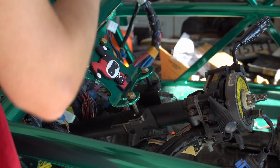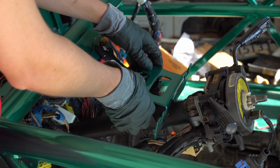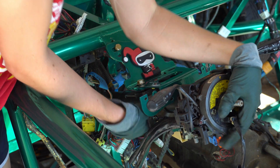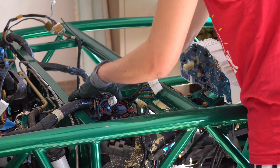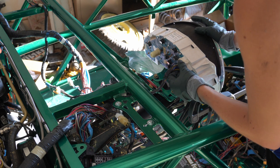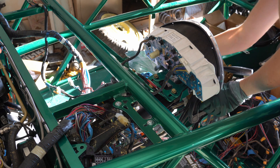At this point I wanted to see where my gauge pod was going to roughly be, so I'm connecting this to see exactly where my cluster's going to sit to get the length required on the wiring harness to plug it in. I want some props for this, because this build really has been a one-woman effort — it's really nice to have a second set of hands, but dang it, you can do it. I started threading this bolt but it's very long and a lock bolt, so I just clamped it in place. I'm trying to see how much slack I'm going to need to plug in to the cluster. It was good to mock it up — this gave me a good idea of how much slack I needed.